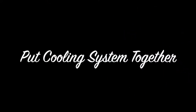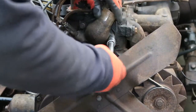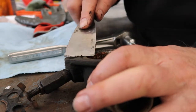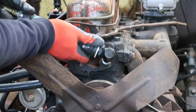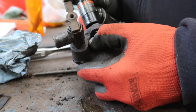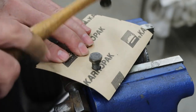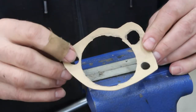Now we'll put the cooling system back together. We need to add the thermostat back in. We took the thermostat housing off and cleaned it up. We used a wire wheel to clean up all the surfaces and also inside the housing. The housing can be a template for our new gasket. We used an old trick of using a ball-peen hammer to quickly get the general gasket outline and cut out the various holes. It's not the prettiest in the world but it should be functional.